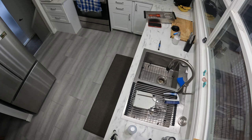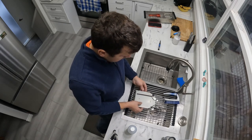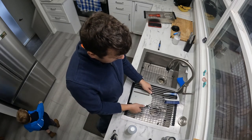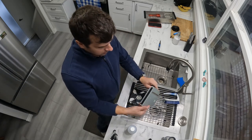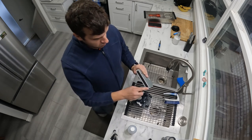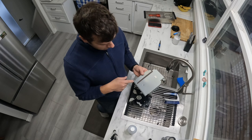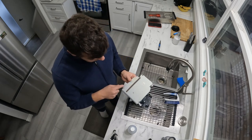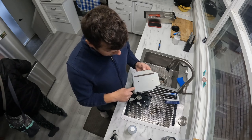And now we're taking out the three screws on top. These are different from the ones you took out on the bottom. These are the flat head style ones. Now we can take off the top shielding on top of the Blu-ray drive, as well as the fingers that accept the game disc, and also the gears that pull in the disc.